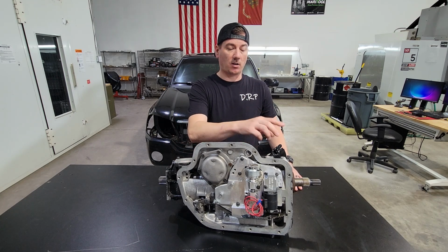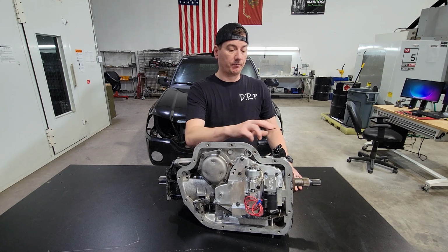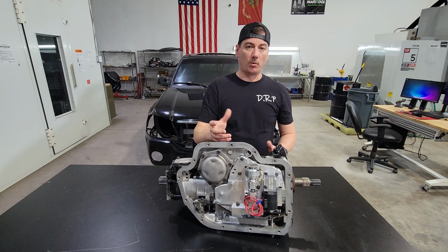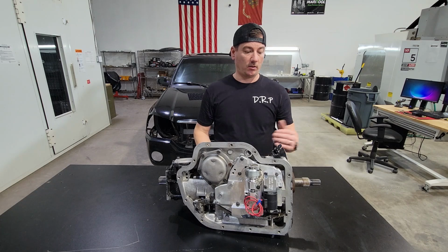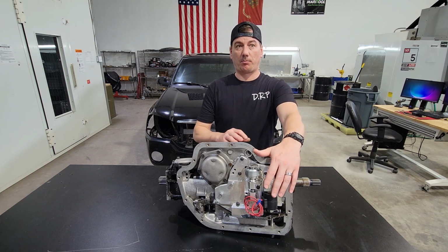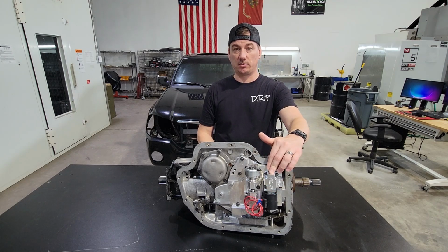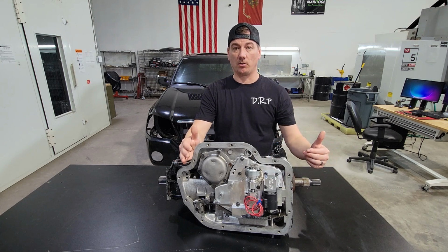We still have a hydraulic system, even if we're going to have a cooler here. Okay, we're not utilizing the external dump, but you could have this and an external dump system. What we're doing is we're starving fluid from the converter. Okay, effectively we're loosening the converter, giving it a higher stall, less load on the converter, less load on the engine, getting it up to target boost. This is measurable, but it's far more efficient having the spool assist solenoid here than it is having an external dump valve to control your converter to help loosen it to get up on target boost a whole lot faster.